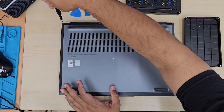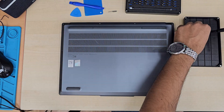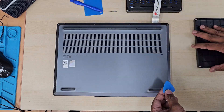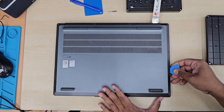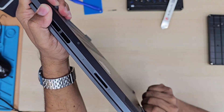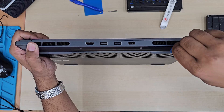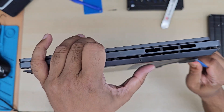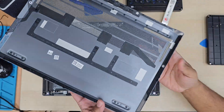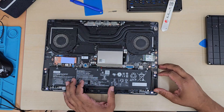I'm going to take out all the screws, starting from the right-hand side and going all around. It doesn't break any clips, so don't worry. It takes about a couple of minutes to take the bottom plate down. Try to use a plastic spudger, because if you use a metallic one, that's going to damage all the clips. As you can see, all the clips are intact.